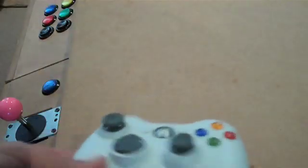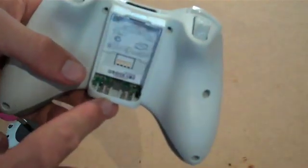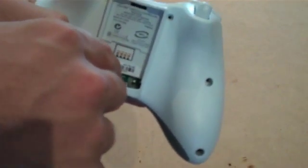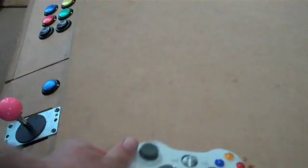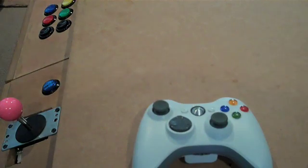Here are all the things you need. Number one is an Xbox 360 controller — this is a brand new one I just bought. The reason I had to buy a new one is that inside the battery pack it says J7 on the motherboard, and it needs to say J7 if you want to use this process, which uses a common ground where each button has a signal. That means half as much soldering. Most controllers sold in the last twelve to twenty-four months should be this style, so new ones are fine, but your old ones might be a problem — it won't be impossible, you'll just have to jumper a ground and signal wire for every single button, which can be a pain.